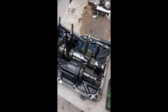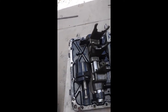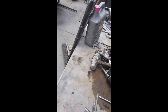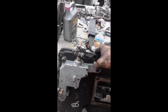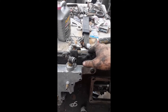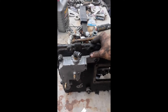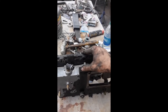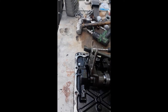We've got the top cover of the transmission off. I want to explain a little bit about what we're doing and why. The condition of the truck was in neutral and high gear it was bleeding air out of the range selector manifold — this guy here. I've replaced it thinking it was faulty, and then it did the same thing. I even went back to Freightliner and warranted it out thinking I got a defective one, but it turns out this is actually doing its job. The problem is much deeper, so to save you some heartache and embarrassment, we'll go over the operation.